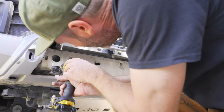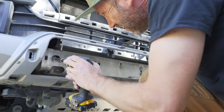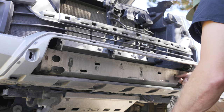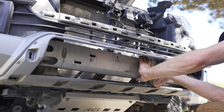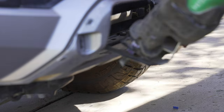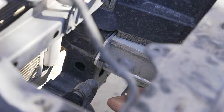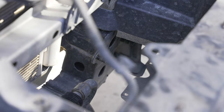That piece there is an aluminum impact absorber. It comes off with three bolts on each side of the front — just get those all off. I don't know what I did before impact drivers. This thing has wings on both sides which prevents it from coming out the hole, so the solution is to just cut one end off with a saber saw. You can then bend it and it'll just come right out — throw it away. These are the extensions off the frame horns that the impact absorber bolts to. There are three bolts and you pull them all off — throw those away as well. There's one on the other side too.